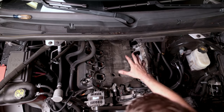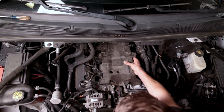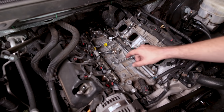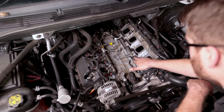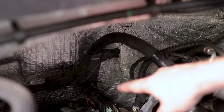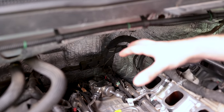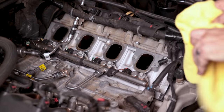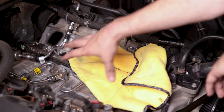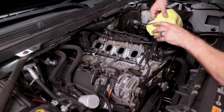Here's what it's going to look like. There's what I think is just a sound deadening or heat barrier material — we'll lift that off so you can see underneath. Here's your high pressure fuel injection system, so if you ever need to replace the high pressure fuel pump it's right there. You've got your two fuel rails, your fuel distribution system, and all your injectors. If you ever need to replace an injector, this is how you get to them. Cover all these holes — stick something inside or cover with masking tape so nothing falls in while you're working.